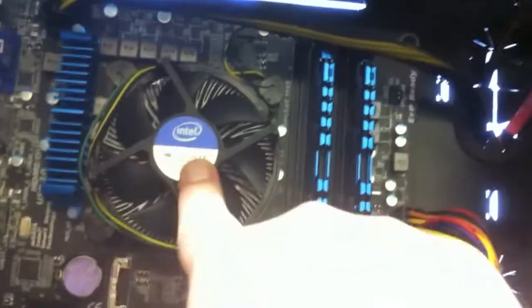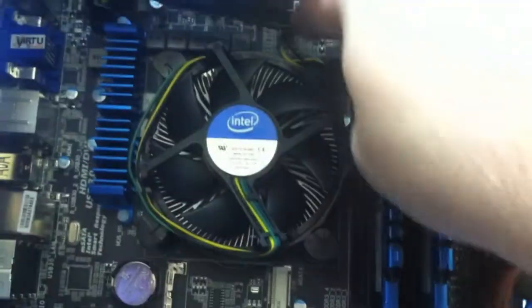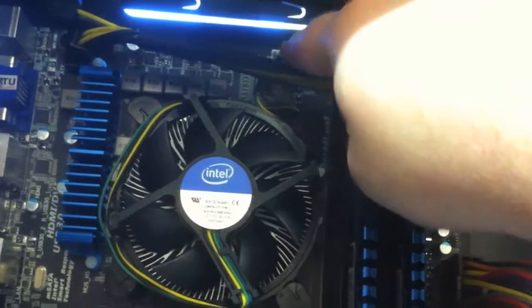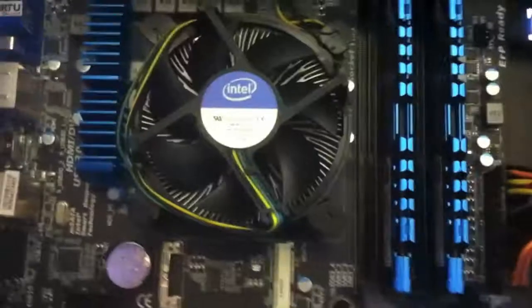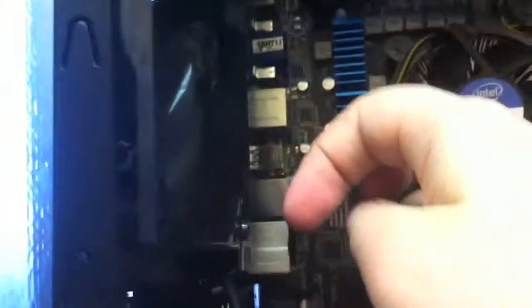So the main ones, and you've also got fans as well, so there should be a fan power there, which normally goes to a socket just up here. When you turn the computer on, the fan pretty much runs all the time. If you don't have that spinning, you might wreck your CPU. So you've got to make sure that one's plugged in. Also, when you turn the machine on for the very first time, make sure that it is actually spinning as well. There's also another fan for the back,